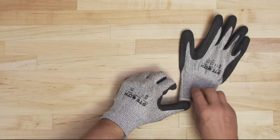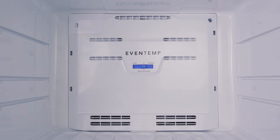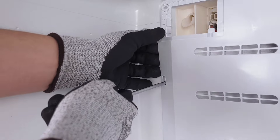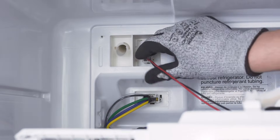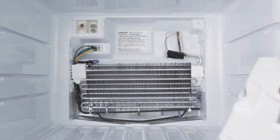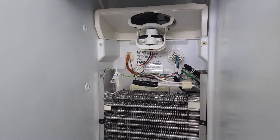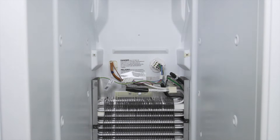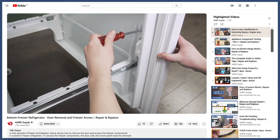Since the evaporator fins are sharp, it's best to wear cut-resistant gloves. To access the evaporator coils, you'll have to remove the screws to the freezer cover panel. Lift up the mounting tabs and remove the panel. If the fan is mounted to the panel, you might need to disconnect the wire harness. In a side-by-side fridge, the fan will likely be mounted above the evaporator coils. To isolate the fan, disconnect the wires and remove it. If your model has a bottom freezer, then you'll have to remove the door to access the freezer components — you'll see how to do this in the video linked below.